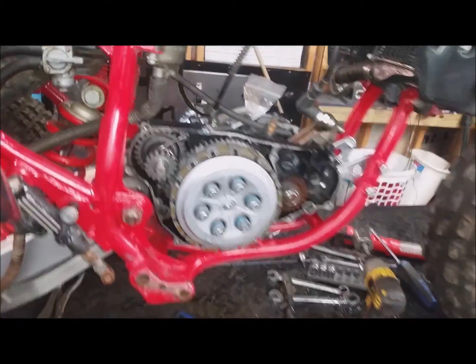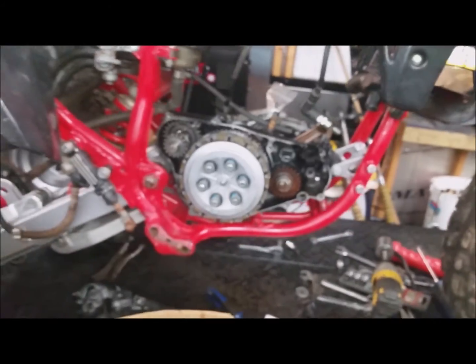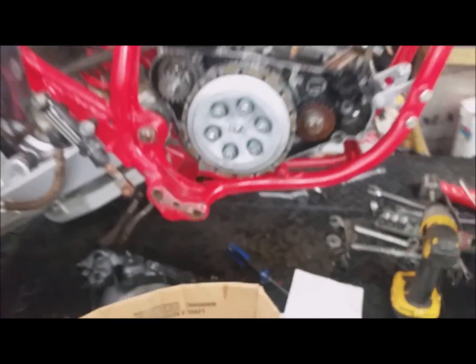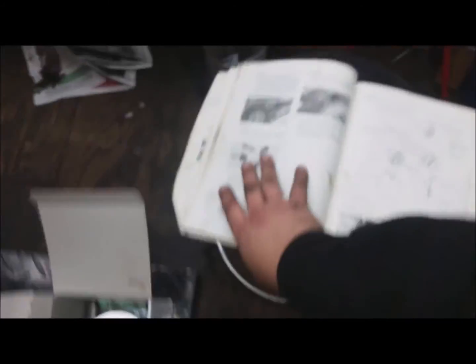That's why, if I ever hear of any kind of barn find rumors or somebody says they're selling an 86, the first thing I check is the case code, and I always go through the gears. You never know. People can swap these parts out. The 6-speed tranny will fit in the 5-speed bottom end, all the cases are the same. The gear sets will swap around. So, check this out.